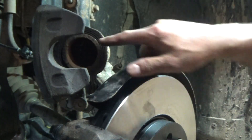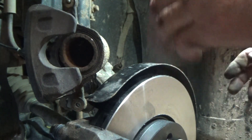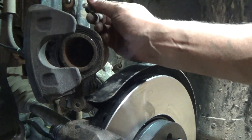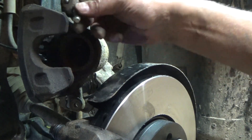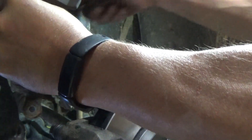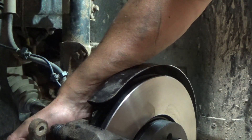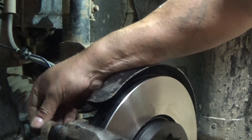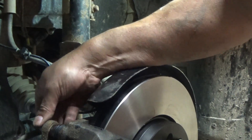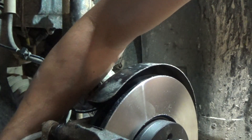When you compress the piston, make sure you don't pinch the piston boot. These are 14-millimeter bolts and they go through the caliper itself into the caliper bracket. Take your hanger off and you may have to manually push the pins in to get the caliper in place, then torque these down — I believe these are 20 foot-pounds. I'll have all the torque specs down in the description below.